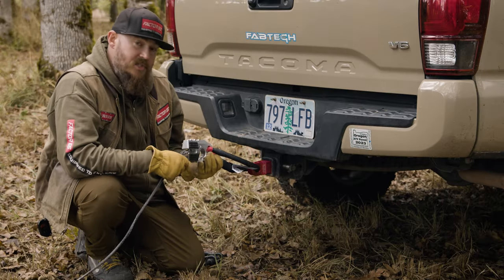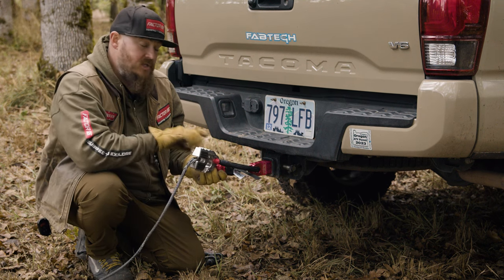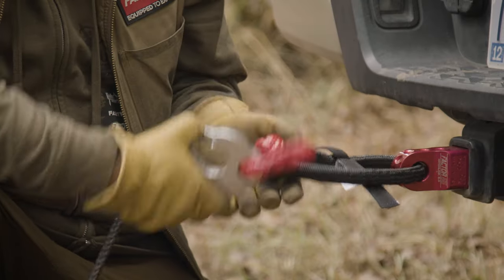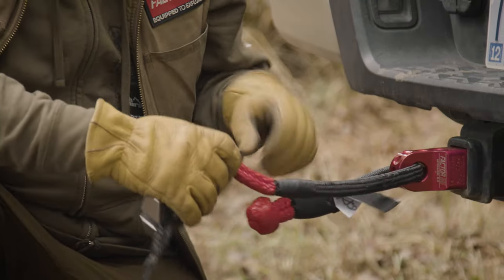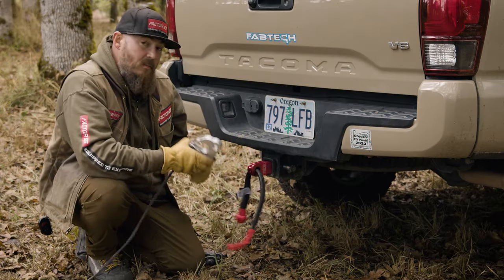As you can see, with the soft shackle set up in this manner, the hook throat is facing down. It's important to make sure that even in this configuration, the finger grips are facing the correct way. It's always fine to reset your rigging to make sure you do that properly — keep in mind the hook is going to face up.